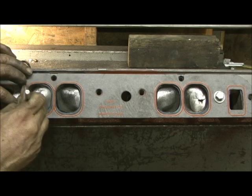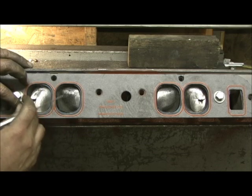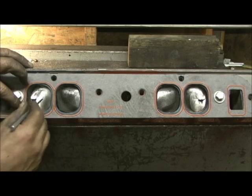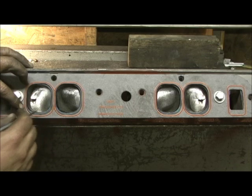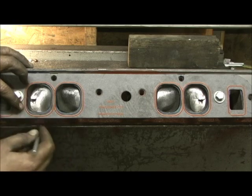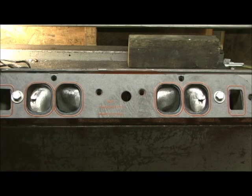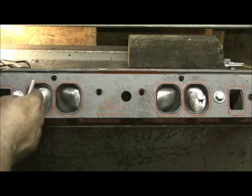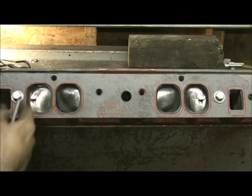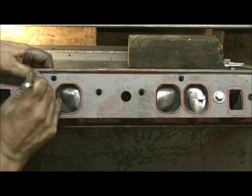You can see where I'm following and then all of a sudden it just falls off right there. On these gaskets like Felpros, what you do is scribe to the inside line of the gasket. Then when you do the manifold, you take your Dremel tool and just touch it and pull it to the silicone bead pretty close so you don't have overhang in the head when you're bolting it on. This is where somebody went in there and chopped a bunch out of the side and a little bit on the roof, but this gasket pretty much allowed me to go in there and straighten it out.